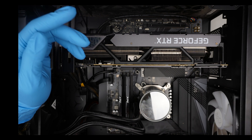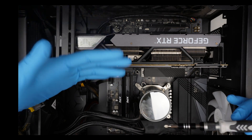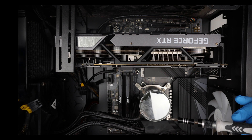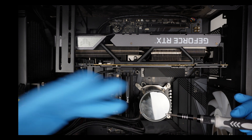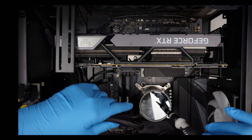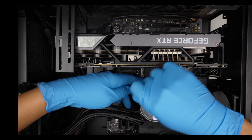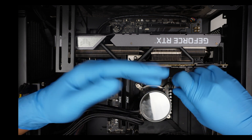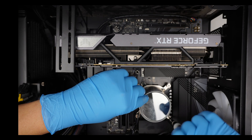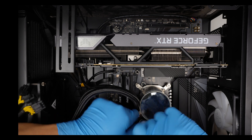One thing I do not like about this mid-sized tower: first of all, all the equipment is on the larger side — the graphics card is big, there's a water cooling system with a reservoir. It's just too compact. The power supply is on top here. So if you guys are going with heavy equipment like a large graphics card or water cooling system, I recommend getting at least a full-size desktop case rather than a mid-sized. You just make things easier to work with and get better airflow.